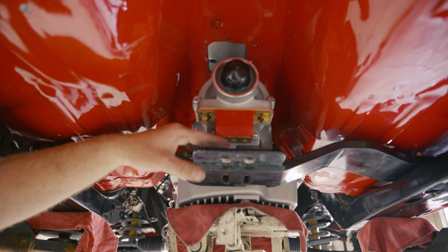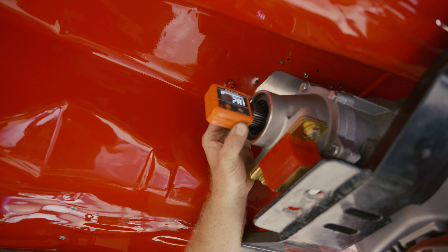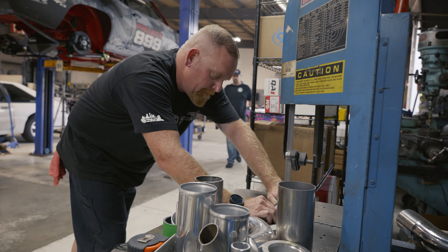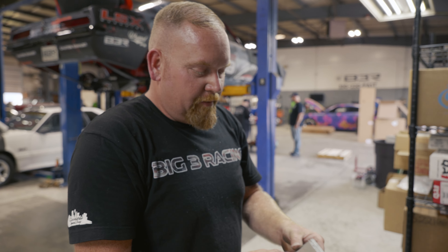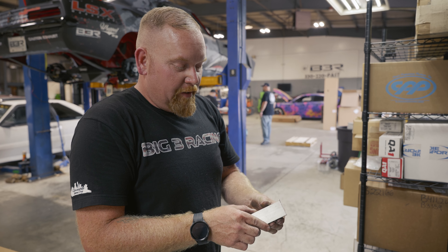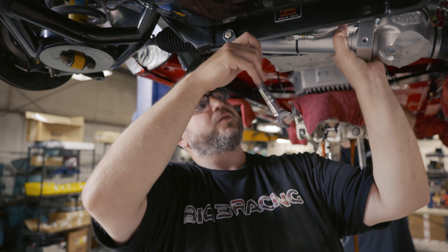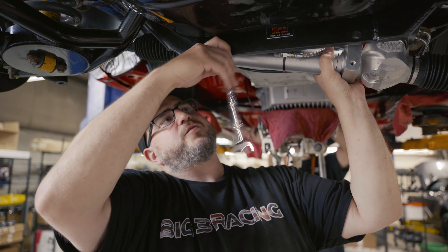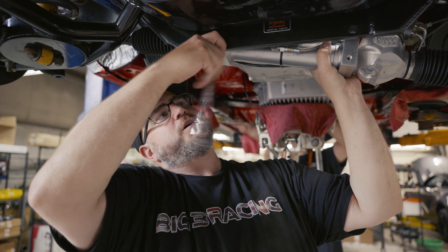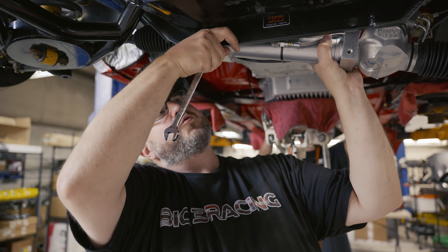It might need a riser — about a half inch. Obviously this is considerably more than a couple of washers, so I'm going to see what I can come up with and just make it work. Our driveline angle seems pretty good — 2.8 down. If I can get two and a half down, but we're kind of hitting the tunnel so I don't want to go up much more. They're going to be the spacer for the back of the transmission — I'll clean them up, drill a couple holes, and try to get the height right. We're also going to machine these billet adapters about a hundred thousandths, just to give us a little more oil pan clearance. It's very close, looks like it might be touching in one spot. So we're going to chuck it up in the mill and knock a hundred thousandths to move the rack just forward a little bit to give us some room.